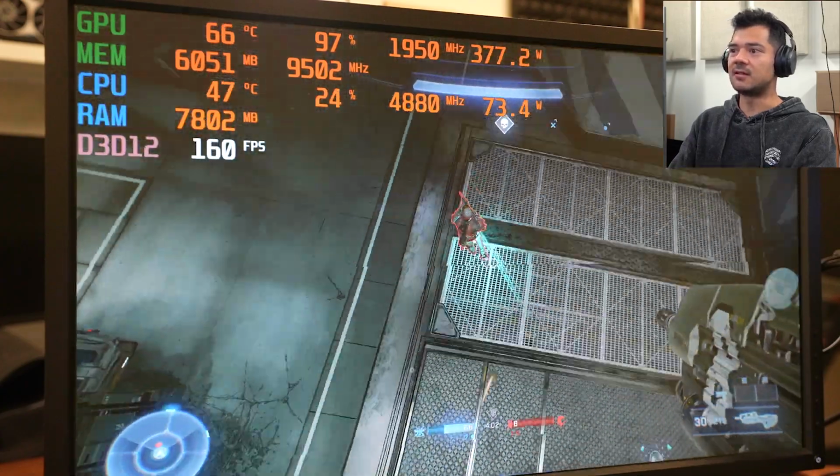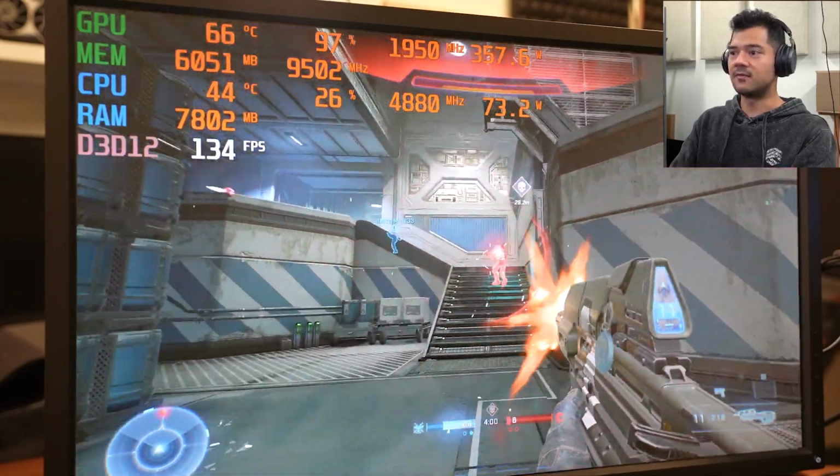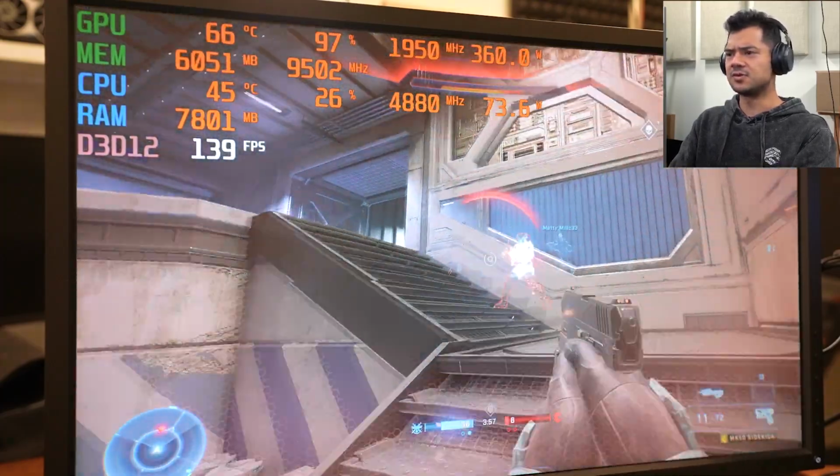The L series fans are actually not too bad on radiators, even though they're not really marketed as radiator fans. I've done a lot of testing with them in the past, used them on plenty of radiators in personal builds, and temperatures have always been pretty good with them.